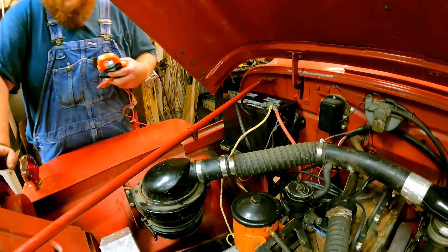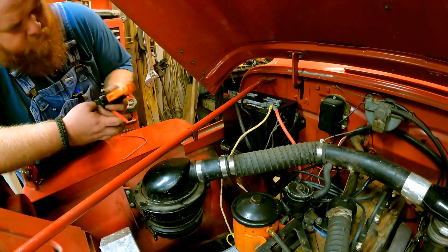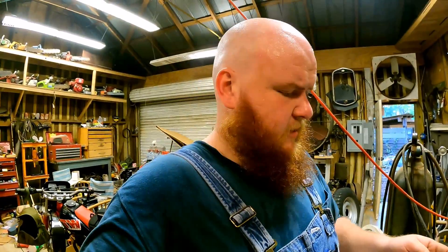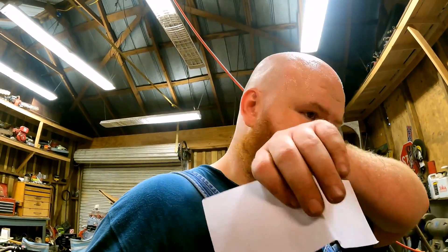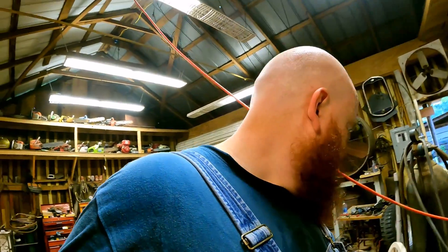Alternator appears to be alternating. The maximum output on this alternator is 14.5 volts. Right now I think it's 13.25, so it does it depending on the needs of the battery. If the battery's really dead, it's going to pump out more energy.